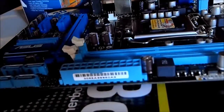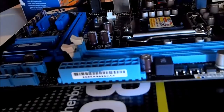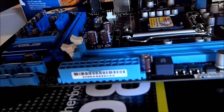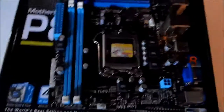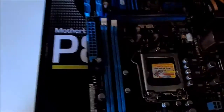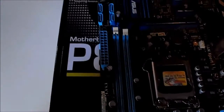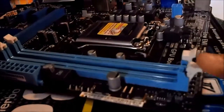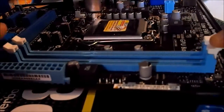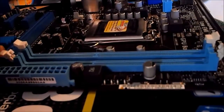This is my RAM — NCP Platinum as I showed before. I just have one stick because that's all I can afford right now. On some boards, both latches pull back and clip back in; on others, one stays in place. On this one, both come out. If you have four RAM slots they'll be color-coded, but this board only has two slots.